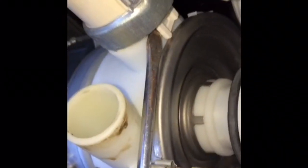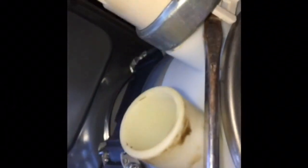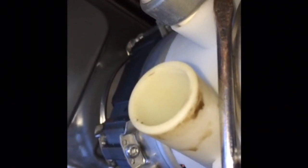You can also check when you remove these hoses that there's not some kind of gunk caught in these ports — these all look pretty good, they were not very dirty. Here's the heater pressure switch, and we're going to use a standard head screwdriver to pry up on this little plastic tab, just gently pry it up. You don't want to break it off — there's one on each side, so you want to gently pry up each one, then you can just lift off the heater pressure switch.